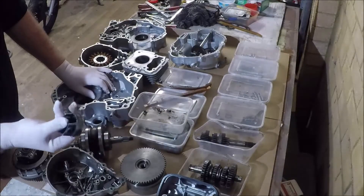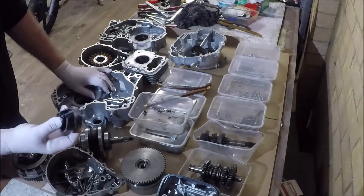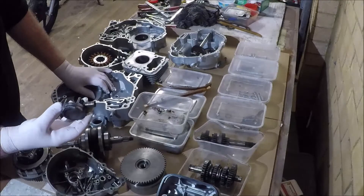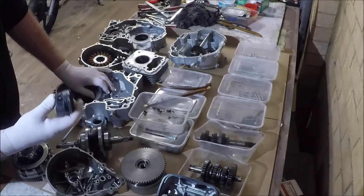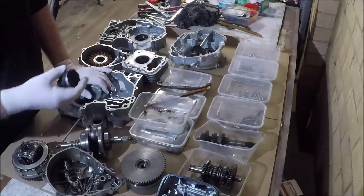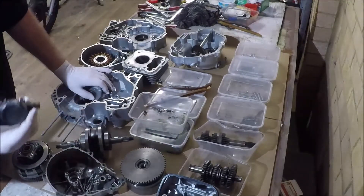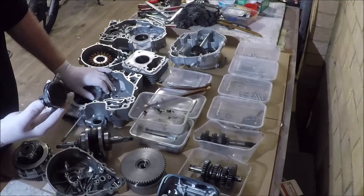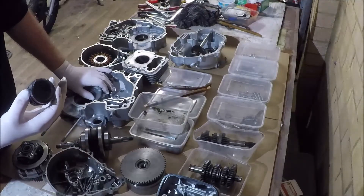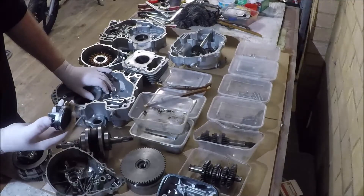If your motor ever becomes rattly and you switch it off in a hurry, you're more likely to be able to redeem the motor than if you try to ride it 100 k's down the street. This is a combination of poor servicing, lack of oil changes, and abuse. A CB125V spins to 9000 revs before it redlines; most of the power is made at seven to seven-and-a-half thousand, and revving its brains out doesn't do any good.